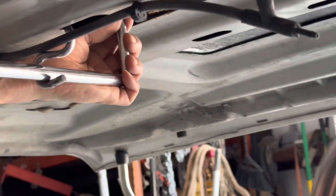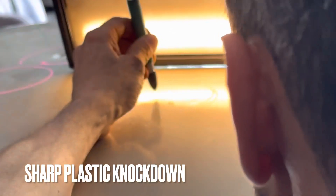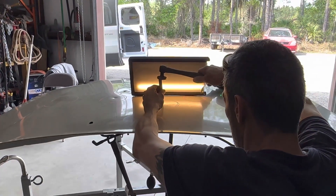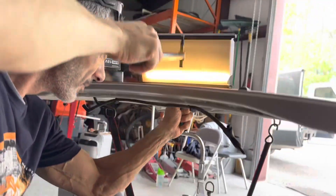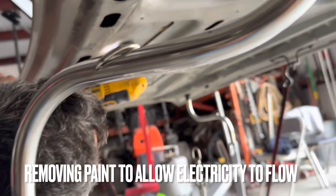With this hood material being aluminum, you definitely want to use something sharper like a needle tip to really isolate that little pinpoint section you're trying to move. From there you'll see us use some sharper knockdowns, basically manipulating this to where it ultimately wants to sink back down. Because the metal is overstretched, we kind of use an off-dolly technique — aiding and keeping the metal up so we can tap down and manipulate as much as we can while we have it in that high state.